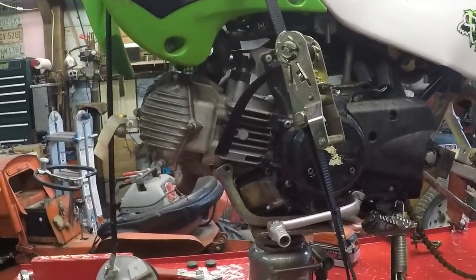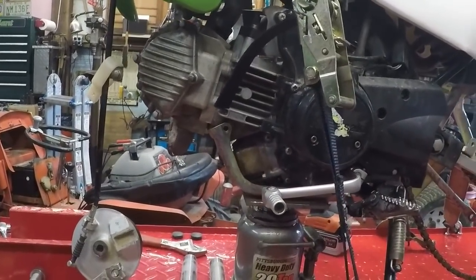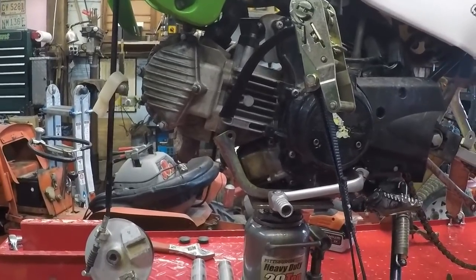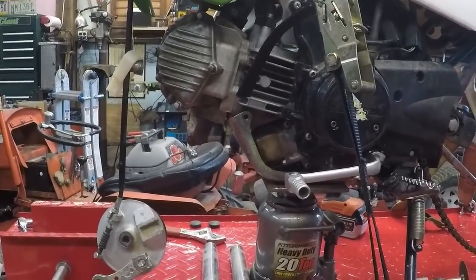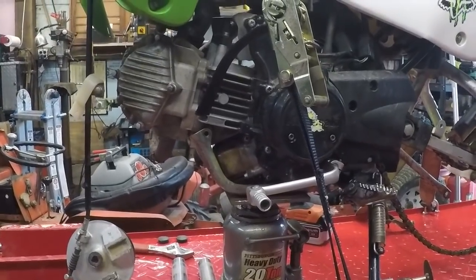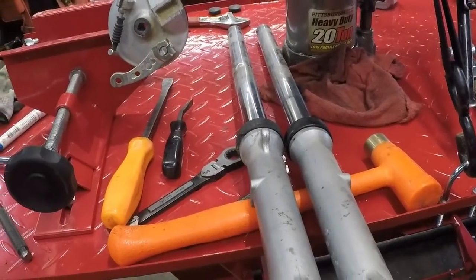Then after we get everything ordered and get everything done that we can get done, we're going to tear into the engine and see if we can't find where that oil leak is coming from. And all I'm going to do for that is pressurize the crankcase and watch for oil coming out of the crankcase. So there'll be a little bit of trickery there. I'm just going to use the spark plug hole with both valves closed and introduce some pressure in there and see if we can't get the oil to present itself where it's coming out. So you guys get to stay tuned for that too. Quite a bit more to do here. So as we go through it, we will continue this series. But for now, thus ends part 2.